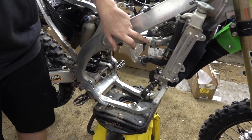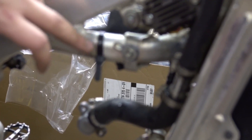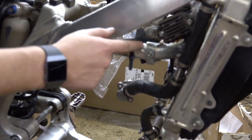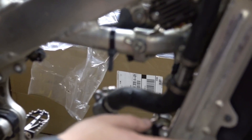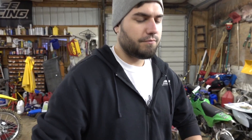Look at the shrouds being on there. This right here is different on the 12-to-15 frames than the 16-to-18 — it's in a different location. Either way, I'm going to have to make a bracket right here for the shroud bolt. The radiators down here are different too, so I might have to make something there. I'm going to throw in the junk bottom end and mount up the pipe so we can see. I have not done this before, so I don't know if the pipe will fit yet — let's try it.